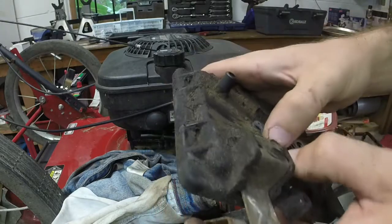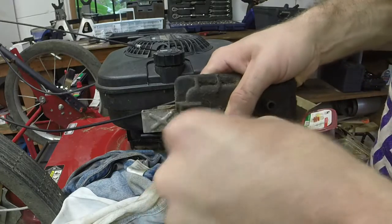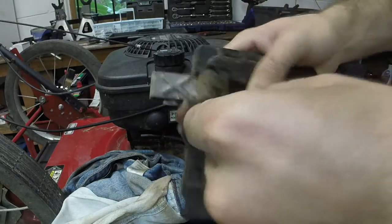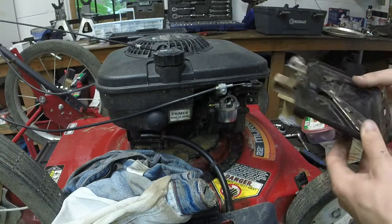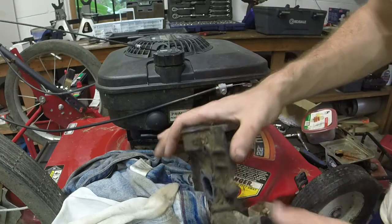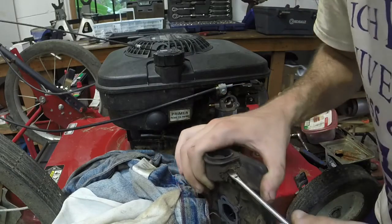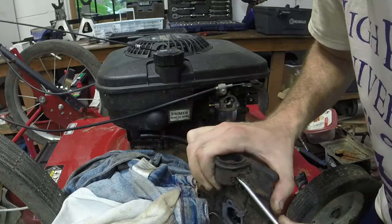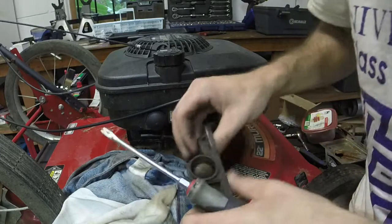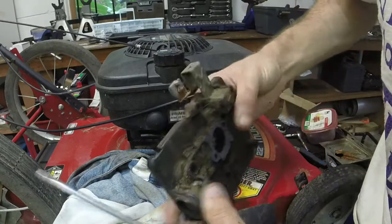All the Quantum engines are kind of getting old now because they stopped making them in what — 2013? So even the newest ones are about seven or eight years old now. They may have made them on Toros a little bit longer. I've got gaskets for days when it comes to these Quantums — sometimes you use two or three of them and they'll get you what you need. I think I mentioned this in other videos — they make special tools to get this primer bulb out, but obviously I do not have them. We're going to pop that tab off the bottom on the two sides and wiggle it up with the screwdriver.